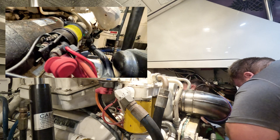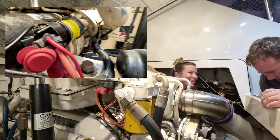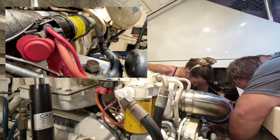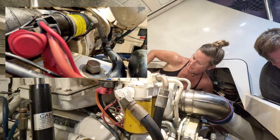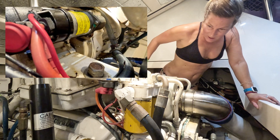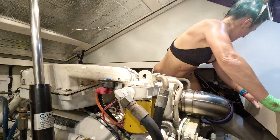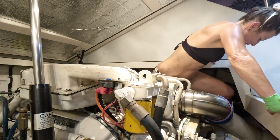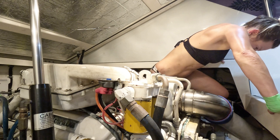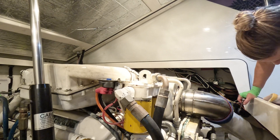I'm removing those two nuts for the large cables. She's putting all the reds on and the yellow and red control wire that comes from the solenoid. This kind of happened a little bit by accident — one night we went to go start the boat and it didn't start. We spent the weekend trying to diagnose it and we thought it was a bad ground. It turned out that was actually correct. We found out the ground issue was inside the starter.